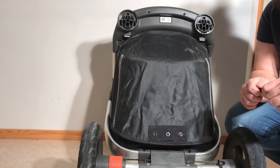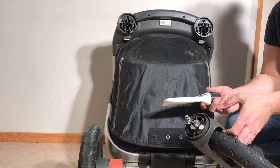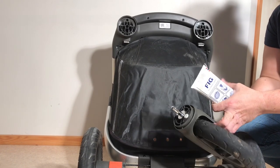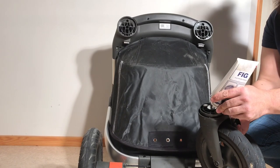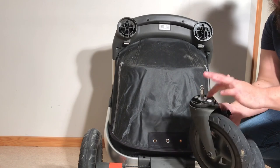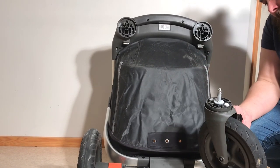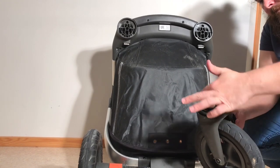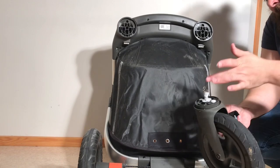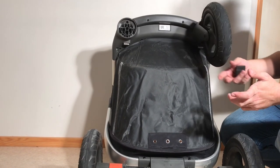The second DIY thing you can do is to properly lubricate the front end. The recommended lubrication for the Stokka Trails is food industry grease. Be careful with other lubricants - the wrong one will make the problem worse. This thick grease is not particularly slippery; it creates tension against movement, providing a protective layer between the front fork and the front frame while making it turn a little slower, as if driving through mud. Apply a generous helping, wash out any previous lubrication first, let it dry, then pop it in place.